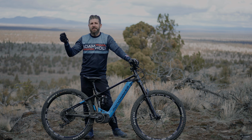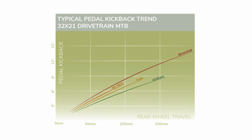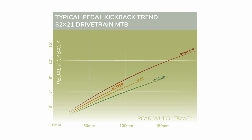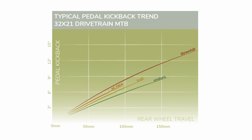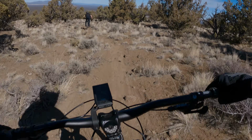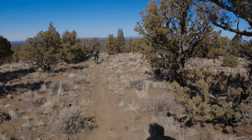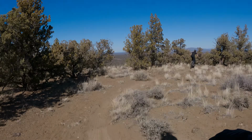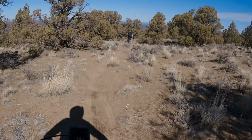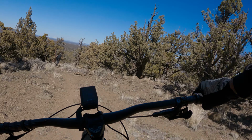You can choose different size elastomers to give you different degrees of cushion, and it'll take it up to, I think, 12 degrees or down to 6 degrees, depending on how much free float you want. So I have the shorter elastomer in here right now, for the smaller, I think it's 6 degrees of play, and I would not want more. I think that would just be too much of a downside on the pedaling and engagement.